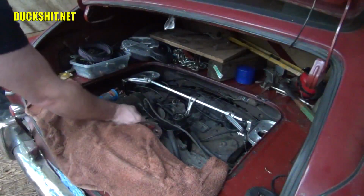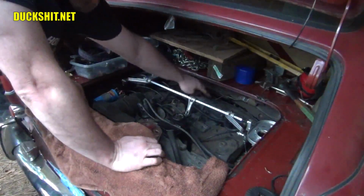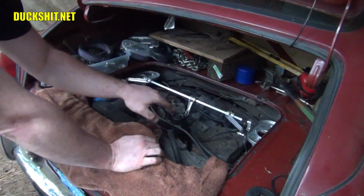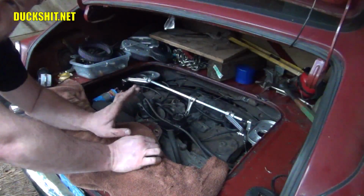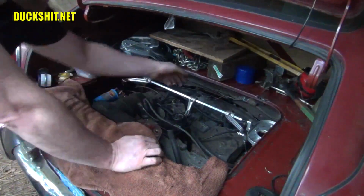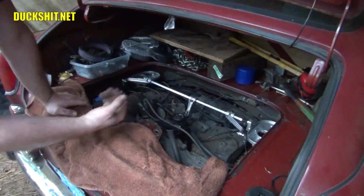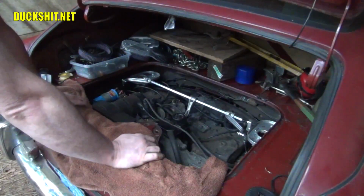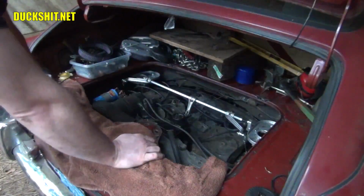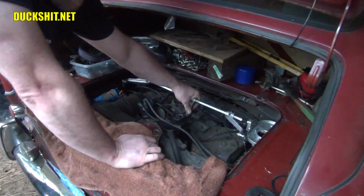What I've done is I connected a throttle return spring in here because I did have some problems with the throttle cable. It kind of comes up over the transmission bell housing there, and it has a little bit of spring tension on it. It wants to flip it upwards, which is of course pulling on that throttle cable. So I put a spring on the back side here, which helps to return the throttle back to the idle position. That seems to do a pretty good job, and it worked on the old carburetor before.